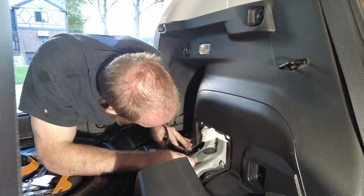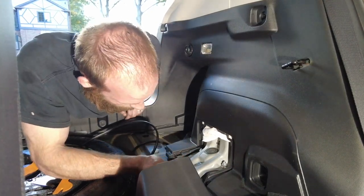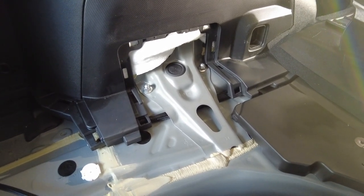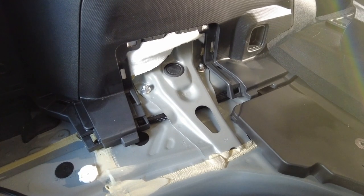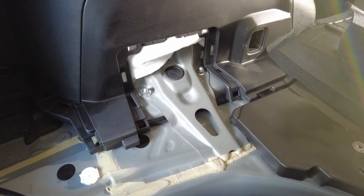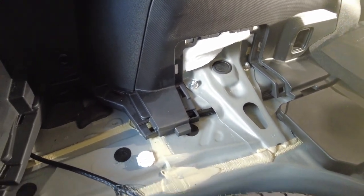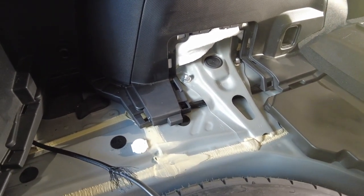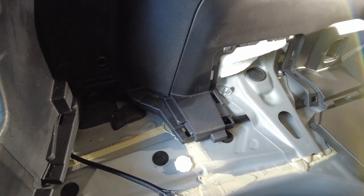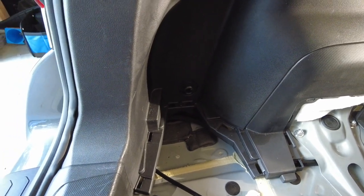I also don't want this wire to get chafed and rubbed. We couldn't get it on video - we just needed both hands. We put wire loom on - you don't need to do it, but it's out of an abundance of caution. Ran about three feet of wire loom down through the footwell, under this shock mount, and under this trim, just because there's really no wiring harness for us to attach it to - just so there's no chafing, just another protection of the wires. Then we're going to end up mounting the outlet right here on this wall so it's out of the way but easy to plug in.